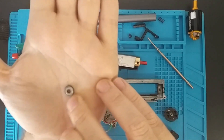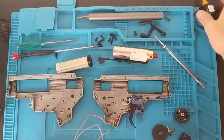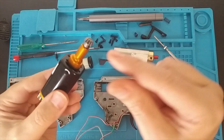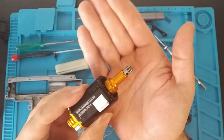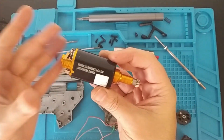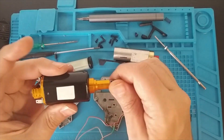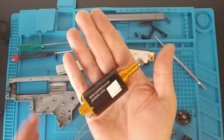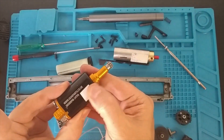We'll do them slightly cheaper to start with just to get them out there so people can test them and try them out. Also, the motor running in all the tests was a Gear Parts 14 TPA motor with an SHS pinion gear - no visible marks on the pinion, in perfect condition. When more of these come in there are going to be some slight improvements: maybe a vent cut in, epoxy on the wiring tabs, and a few other fitment issues to be fixed. Really happy with how these worked out - I can't feel any heat coming from the grip at all.